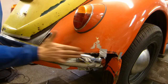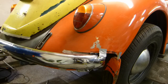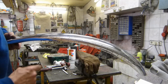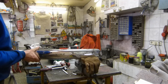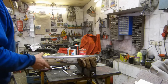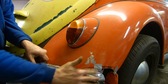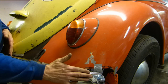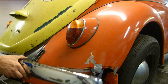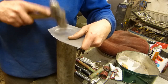Then we finish with the fender and the front. My plan was to paint the bumpers later, so I cut the bumper with the cutting disc and bent it slightly against its radius. It was already too much — too far out — so we had to go inside. The bumper fit, the holders are welded, and now I had to make the transition to the fender.